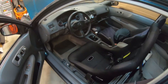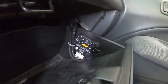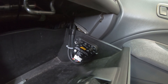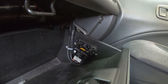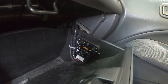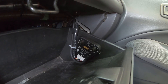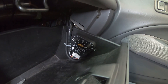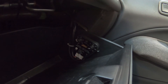Hopping in the car — again, excuse the mess; we went to an autocross and basically put it away wet. Right here in the glove box we have my control unit. There are a couple of different ways to set it up using the two knobs. One controls the flow rate; the other controls the cutoff point for when it will start injecting based on your boost reference. Mine's set for about 4 psi, which is the left knob. I chose 4 psi because it's very easy to make small amounts of boost just creeping around — even taking off from a stoplight you can get like one or two psi accelerating normally. I let the tuner decide the flow rate based on his experience because I didn't want to guess and risk engine damage.